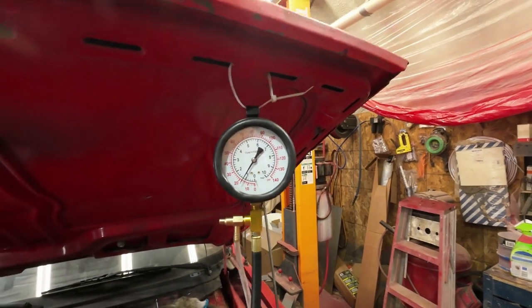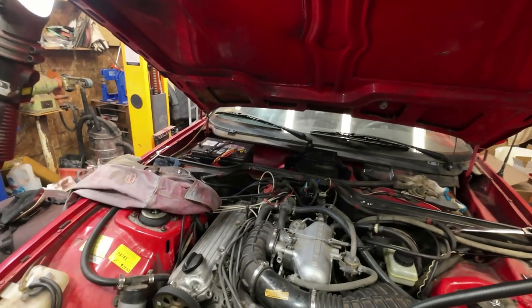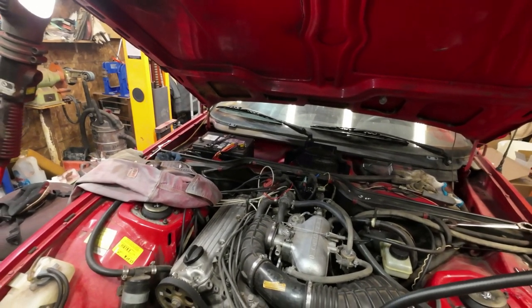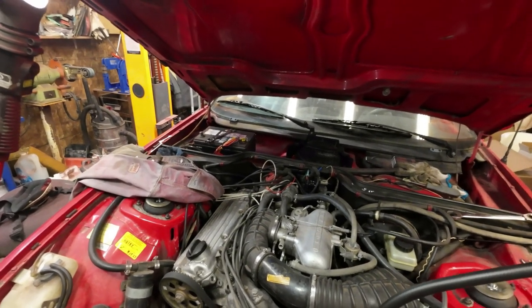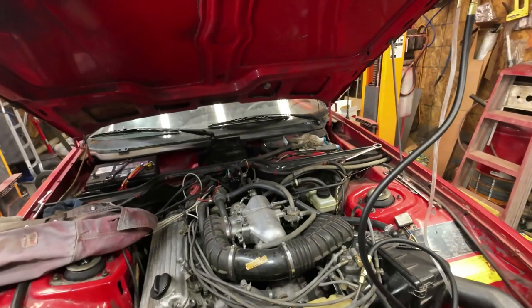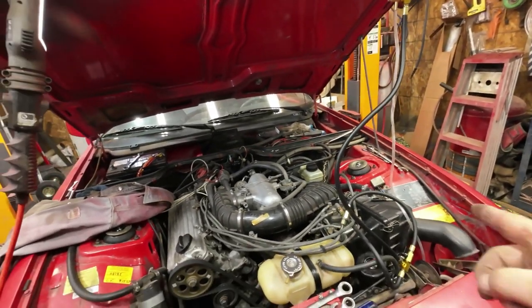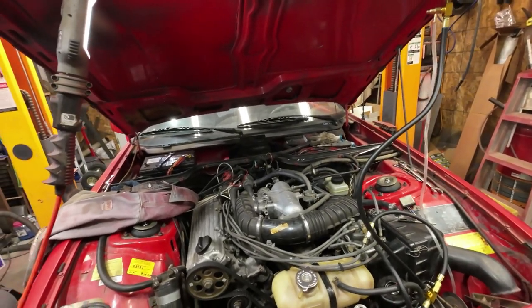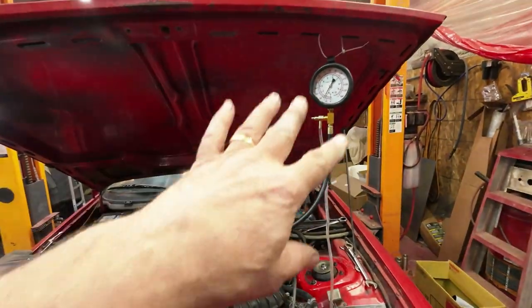So that's again fault in the cold start valve. So I'm going to take the cold start valve out and I'll clean it up because I think I likely have something going wrong in there. But you know how much I love to do things about five times, and I've been in there a couple of times already, so I'm getting good at it. Anyway, that'll be tomorrow, because today I've got to go out for supper in a little while, and I can't do any more today. But I'll just leave that overnight and see what it's at in the morning.